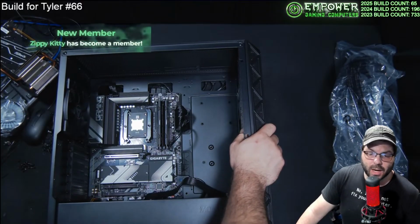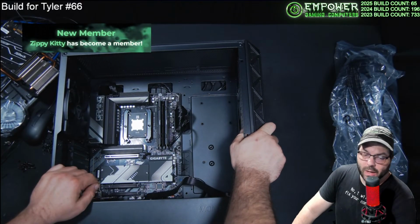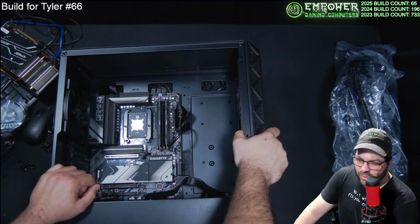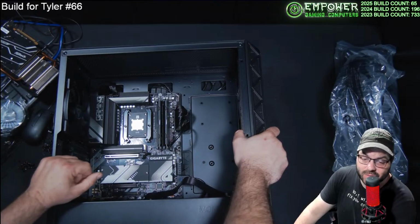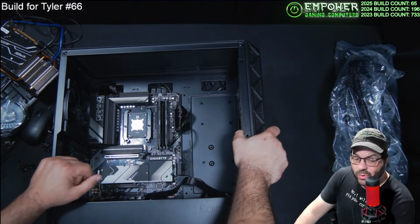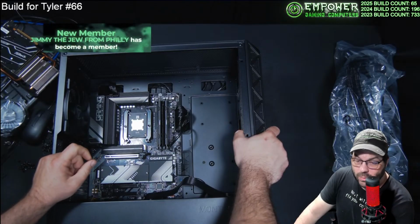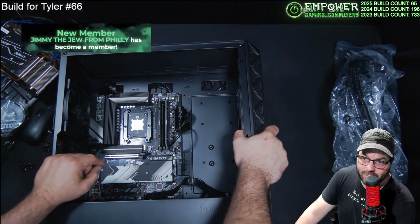Click the globe icon to go to the network and internet, and there's still no drivers. Then you're going to have to download the drivers, because I think your Windows 11 installation media is so old that it doesn't include your motherboard Wi-Fi drivers. Or your motherboard doesn't have Wi-Fi. Didn't think about that one, but...